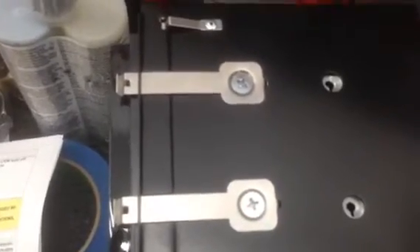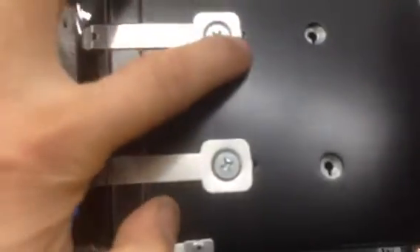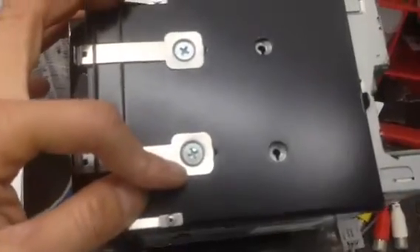You want to put the silver pieces on the outside of the brackets, through the front hole. These are going to be the little spring-loaded tabs that hold in the front fascia piece. Then use the flush mounting screws that come with the radio. It has little guides in the radio chassis, so you kind of know where you need to fall into place.